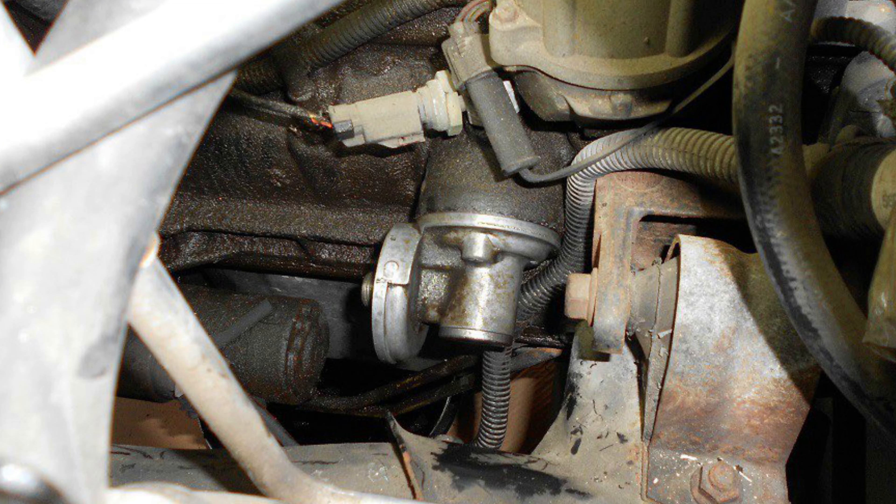Another problem with the 4.0 is it leaks tons of oil. Even mine leaks oil — leaks it actually pretty good. The number one oil leak is your oil filter adapter. These things go out all the time — you get six months to a year out of them, so just get used to changing them. A lot of people will screw the oil filter right against the block, which I don't recommend, because I've seen the motor mounts bust and the engine come up and drop back down and bust the oil filter. I would leave the adapter on there and just replace the seals. They could have come up with something different and better over the years, but they didn't. Easy job — takes about an hour.